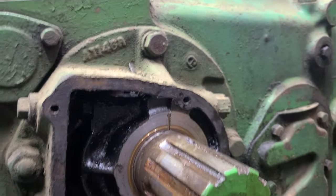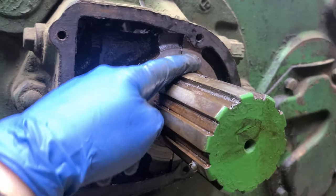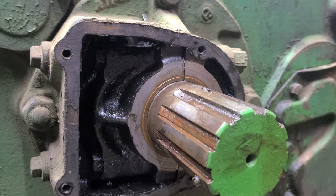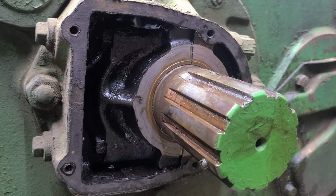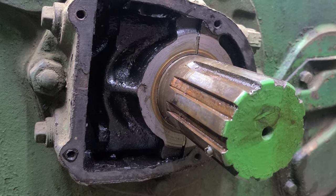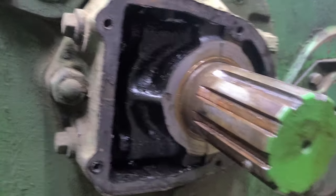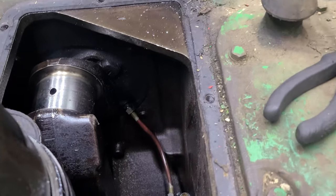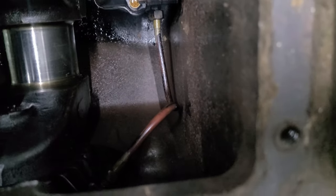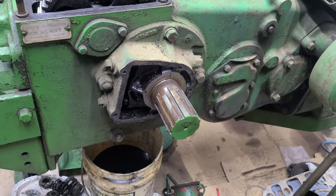It's supposed to have clearance here — I think around three thousandths. It's shimmed with shims right here, and these are babbitt bearings, just like the connecting rods — babbitt but like insert babbits. We'll take this apart and get this crank out. Before pulling on things, don't forget there's an oil line attached to that main bearing and another oil line right there — disconnect those before pulling.